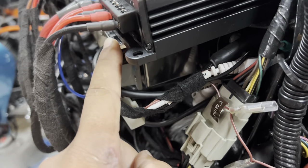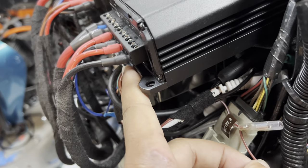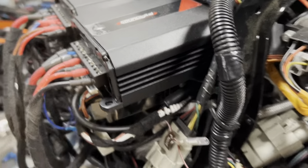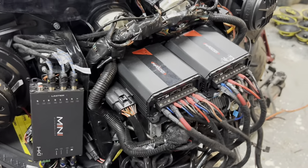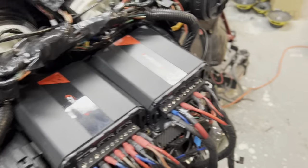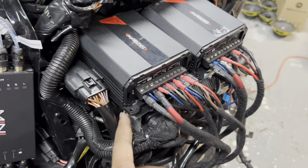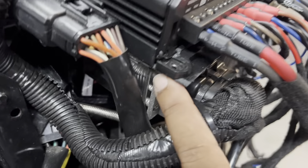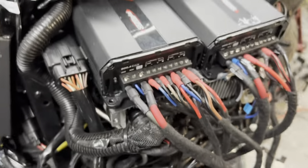There's the radio body there. As long as you can get the base of the amplifier flush with the radio body, the fairing's going to close. I literally just got this question this morning on a kit that we shipped out — it's the same exact kit, so I know for a fact it fits. The Rockford radio on this bike is the same exact height as the OEM radio. If you make sure the amplifier is flush to the end of the radio, the fairing will close.